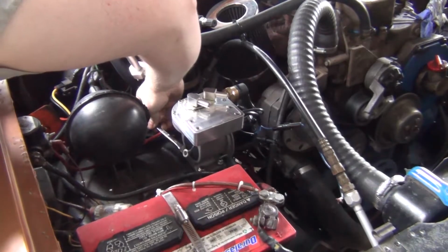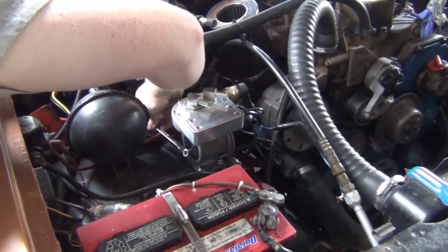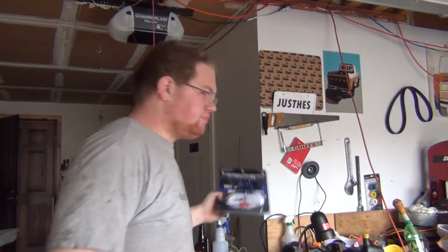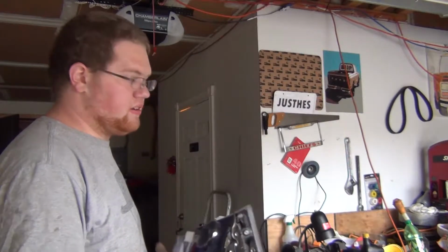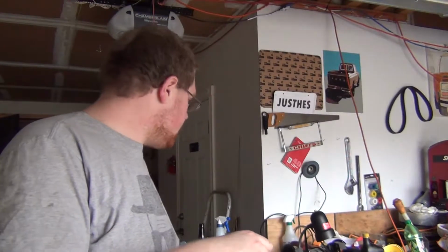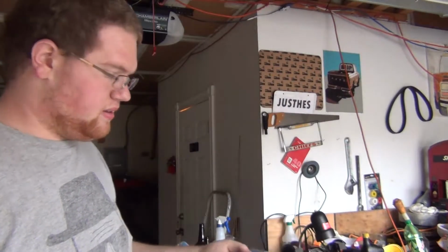So I'm not gonna go too tight. I just want to make sure my bolts are all the way into the nylock. I'm just gonna make a new ground, and I'll run it over to the negative of the battery. I want to have all this tied in directly to the battery, because I don't want any shenanigans of one connection having a little bit too much resistance. Damn it! I don't think I really needed to cut this open, but I think it was either way.